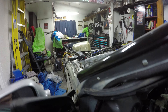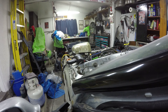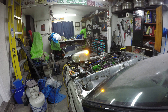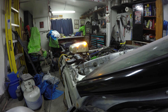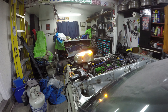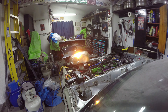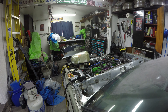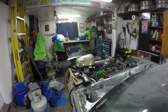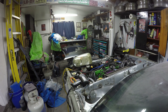I've got the headlight all temporarily wired up. I'll turn on the park light and the headlight — that's bright on high beam — and then the turn signal. That is actually a bulb turn signal. When I had the LED in there it flashed quickly. I had LEDs in both front and rear on the blob eye and they worked fine without any resistors. I did pop in one of the resistors I had and it didn't do anything, so I'm not sure what I'm going to do to get the LEDs to work or if I'm just going to put some brand new amber bulbs in for now.